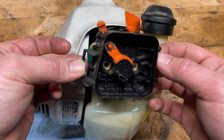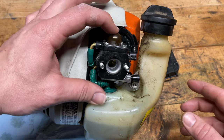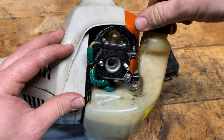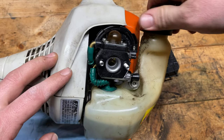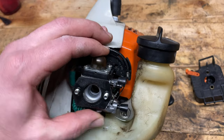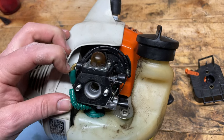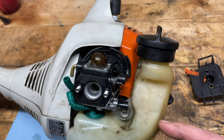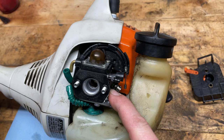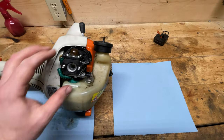The air box comes off like that — and there's our carburetor, just like that. Super easy access. Now, if you've been priming and priming, remember this fuel tank and fuel system is pressurized. So if you take the pressure out by undoing the gas cap when you take these lines out, you won't have to worry about fuel squirting everywhere. There are three things holding this carburetor: the throttle cable, the fuel return, and the fuel in. You can use your finger on these — they're not on very tight. For the throttle, all you really do is press down just like that. Hold it, let it go and hold this up, and the cable will undo itself from the clasp. Then the carb can come off.